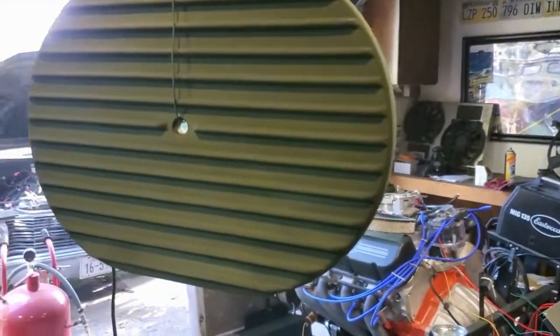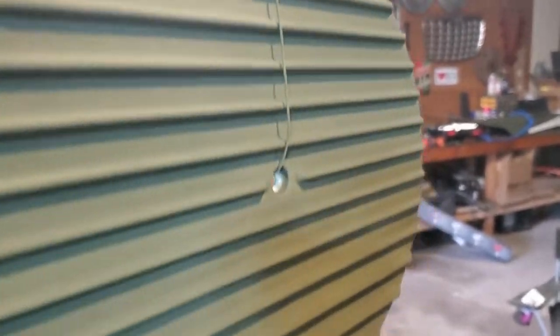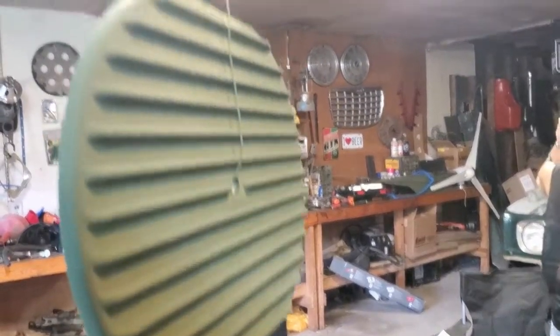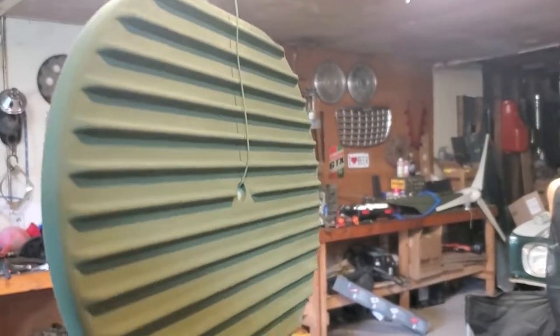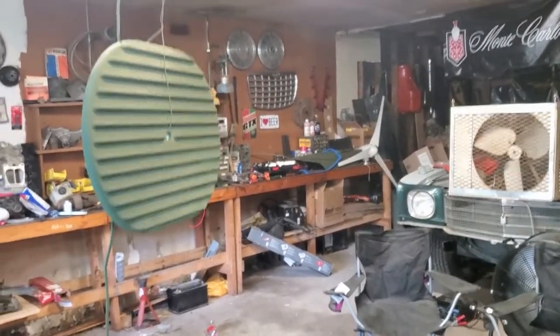We switched back to a higher voltage, and I mean it is really nice. Where we've got our wire though, it's just messing with us really bad. So what we're gonna have to do is same thing. We'll have to coat it a second time. But other than that, it adhered really well. So we'll bake this for 20 minutes, let it cool down a little bit, put the wire on going the other way. So basically flip this upside down, and that'll actually get us completely set up.